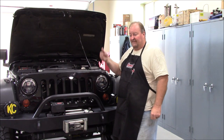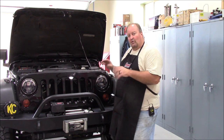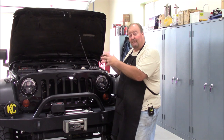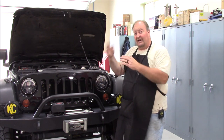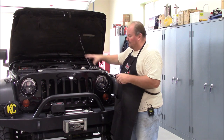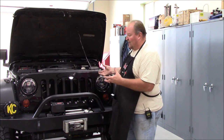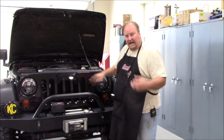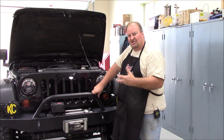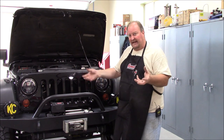So if you're trying to go down the road at 65, 75, 80 miles an hour, you're pushing the throttle down, burning more fuel — and fuel is energy, energy is heat. All that fuel is being burned and turned into heat. You don't create energy, you just transfer the form of energy. Fuel is being transferred to heat, then to rotational energy through the crankshaft. As that heat comes off the engine, it's got to come out through the cooling system. The more you push that vehicle to punch through the air, the more drag, the more energy it's consuming — and therefore heat goes up and it becomes harder to get all that heat out.